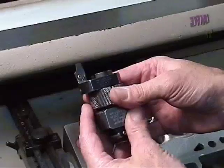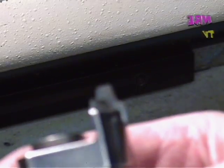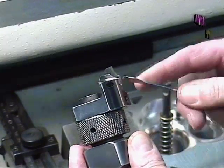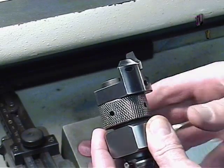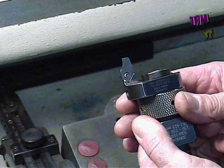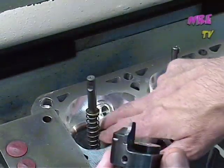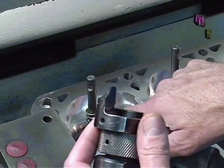This is the insert cutter. If you look at the insert — that carbide blade right there — this carbide blade has all your radius and angles cut into it. This is what actually cuts the valve seat, all across this edge here. And that really is a huge part of airflow — that shape right there. It's crazy to look at something that small being such a big deal, but it is a huge deal for horsepower. Knowing what shape to put on that valve seat is what allows the air to turn around the valve. This is what we call a form tool, which has multiple angles or shapes in it that leaves the positive of it onto the seat surface.